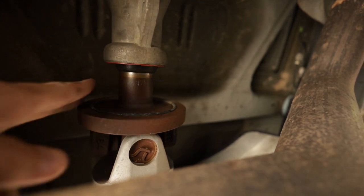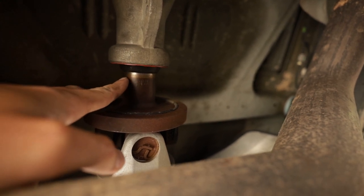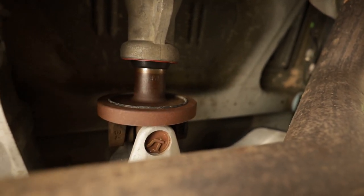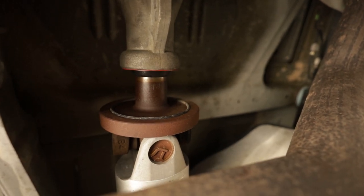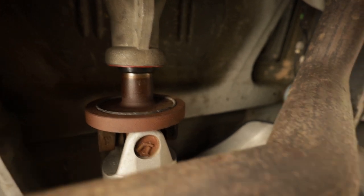As you can see, it's pretty much back to stock. This is the original witness mark right here, so it's only about a quarter inch from where it was stock with a five inch lift. I think this is probably a good mod to do if you've got a WeldTech lift. I'm just out on a test drive making sure that this driveshaft spacer hasn't caused any vibrations. I don't expect that it has, and so far so good. Super straightforward, really easy install.